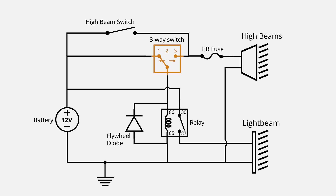When we switch to position number one, the relay is directly connected to the battery, energizing the coil and completing the circuit, turning on the light bar. Alternatively, if we switch to position three, we now have a connection to the high beams — achieved through a fuse tap in my fuse box. The high beams are powered when you activate them through your normal high beam switch, which on my truck is on the column. When that switch closes, completing the circuit for your high beams, because we are tapped into that fuse, it provides power down to your coils, energizing them and turning on your light bar at the same time as your high beams.